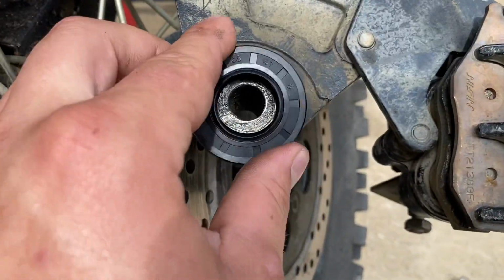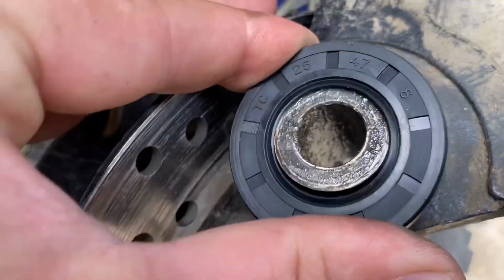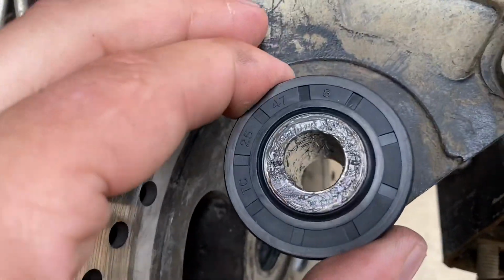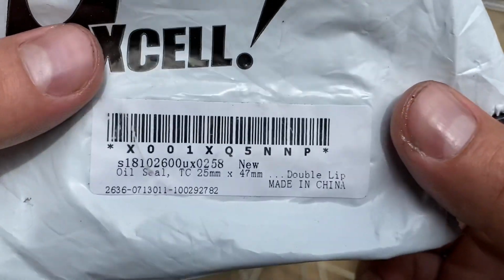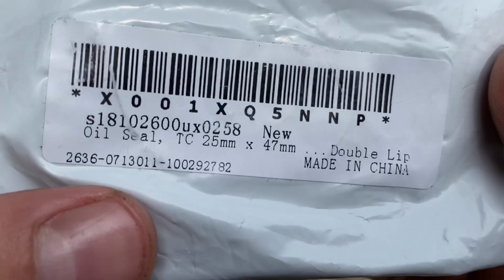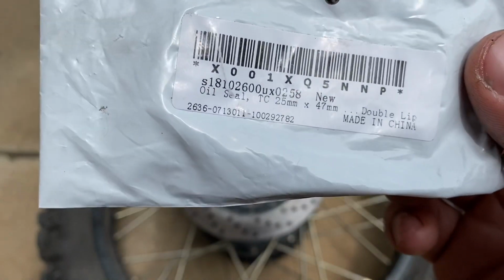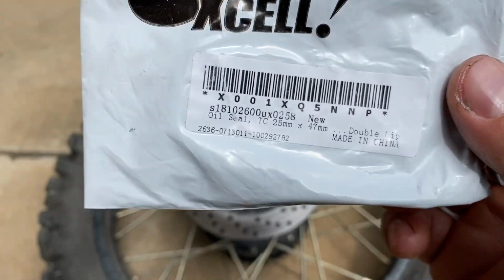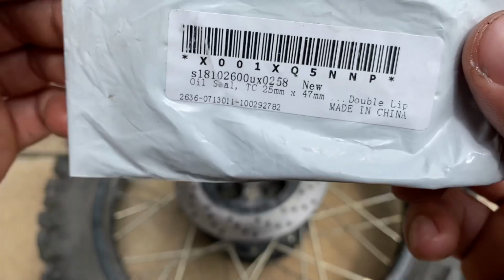Now, if we go to pop this on here, it's snug, but not too tight. That's exactly the fit you want. So this seal is perfect. This is all the info on the correct seal here. I'm not sure which number on here is a part number, but it'll all be outlined in the description box below. Once again, it's a 25 by 47 by 8.